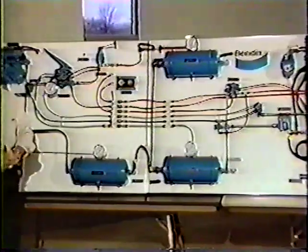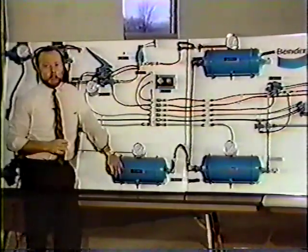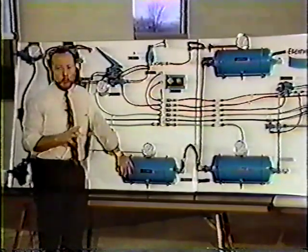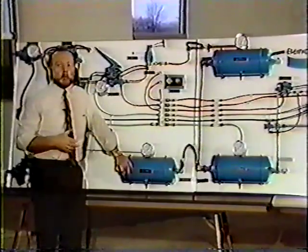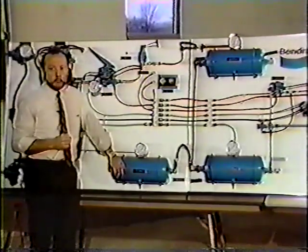If we don't have an SR1 on the vehicle, we could do this, and we'll come to a stop. However, using it in that sense, you are either on or off. There is no in-between. There's no gentle stop. The SR1 will provide us with the proper safe stop in case of loss of rear axle pressure.